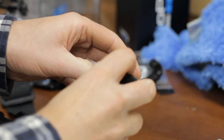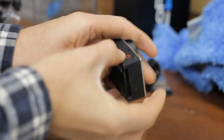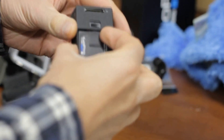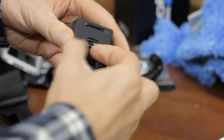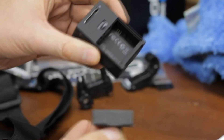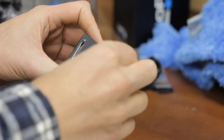But if you have a Hero 2 that freezes, then there is a fix. You have to install the older version of the Hero 2 firmware before the Protune was added. The only way to unfreeze your GoPro is to temporarily remove the battery. The Protune firmware causes freezing regardless of whether you enable Protune or not.